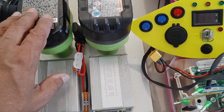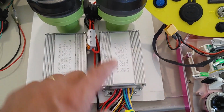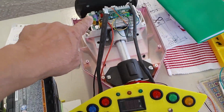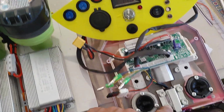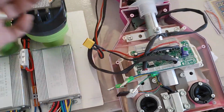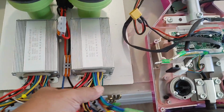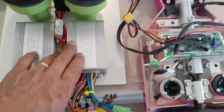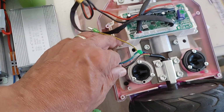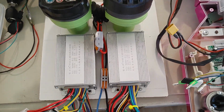power delivery system here. Two Ryobi batteries, 18 volts apiece, 36 volts DC total, feeding two of these speed controllers, which independently control each of the brushless motors that are driving that go-kart. I have this hoverboard here opened up as an example, because it's what I've been using to test it, so that I don't go outside and connect this to my go-kart yet. The weather's a little bit hot, and so I've been using this hoverboard to test the motor here, to test the speed controls and make all the settings and get familiar with all the controls.